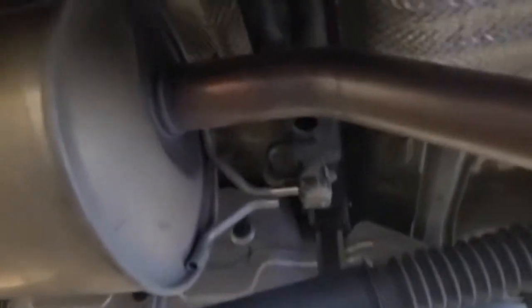As we pass through to the very large stock muffler, you can actually see that the tubing itself, as it goes into the muffler, has multiple pathways, and you can tell it's partially chambered and partially packed based upon the temperatures that you see here. This is an area where you see a lot of heat, which typically indicates an unpacked or chambered section. Where there's a lot of insulation, that typically indicates a straight through or perforated tube section.